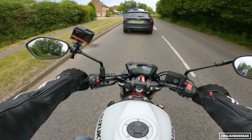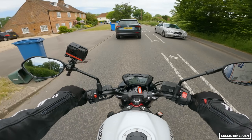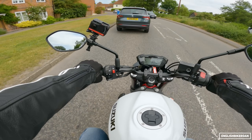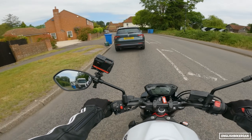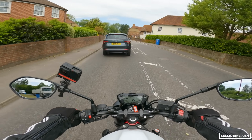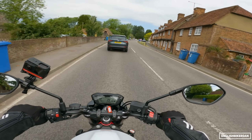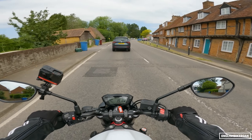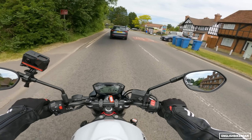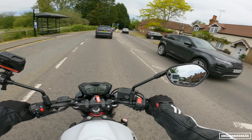Riding position generally — it's just one of those upright sit-up-and-beg style bikes. My top half is very upright. Bars feel fairly narrow, and as I said it's the narrowest bike in the category at 760mm. Ground clearance is about 5.3 inches for those that need to know. The weight is 200kg ready to ride, or 441 pounds.